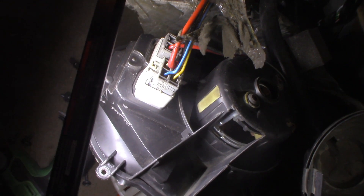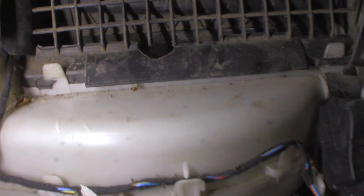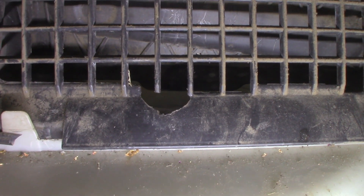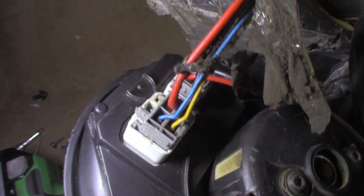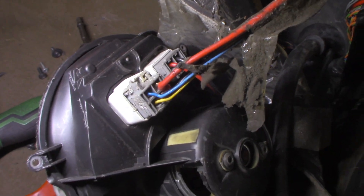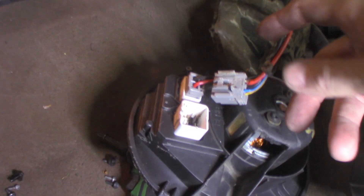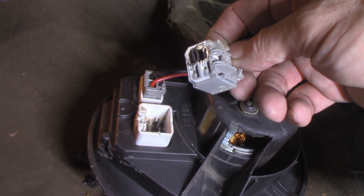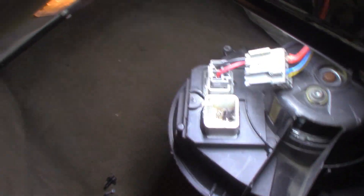I'm not sure if that was chewed on by a critter because it looks to me - right there - you see a hole? I think there was a critter in here that chewed through it. Now did the critter do that? Possibly, but could be that somebody was in here before too. Let me get that apart and test this wiring and then we'll test the motor. Got the connector off - look at that. That is not good at all: melted on one side, corroded. And then you look down on the control module here, the module for the fan - it is just as bad. It is no good.